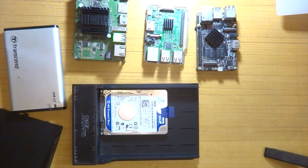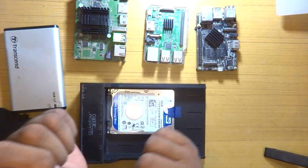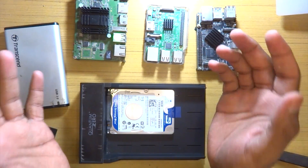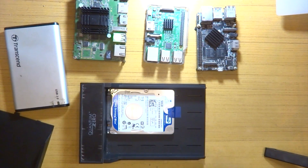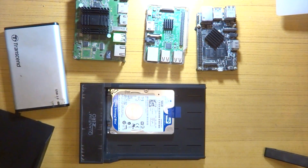For future improvements, I need a gigabit internal network so I can actually saturate the USB 3 throughput. For gigabit, I'd also need a single board computer that supports gigabit — maybe I'll get one, maybe not. I also need a bigger hard drive: 500 GB is not enough. I have a large collection of OS ISOs and all the videos I've ever created saved on my internal hard drive, and I'd love to export that to an external NAS setup like this.